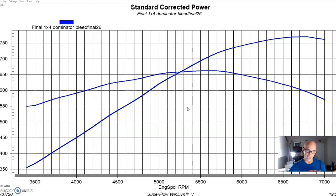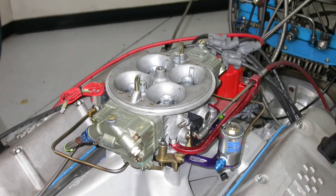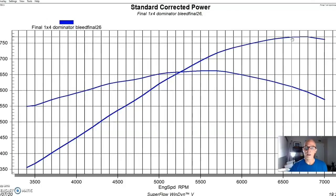So what we have is our 540-inch motor with our Dart Pro 1s and our roller cam, and this is with the single 4-barrel, the same way that we ran it with the nitrous. The reason I chose that as our baseline is because I know we made more power, especially with the ported Dart tunnel ram back in part 2, but none of these blower combinations got the benefit of running with the tunnel ram. It would be kind of cool, but it's a little bit harder to set up, especially with a dual quad.